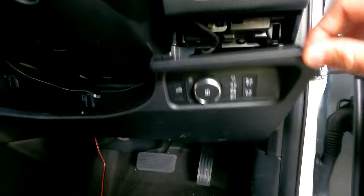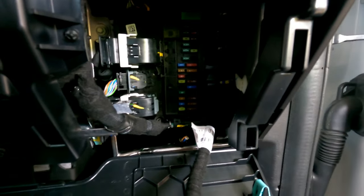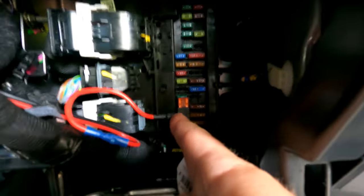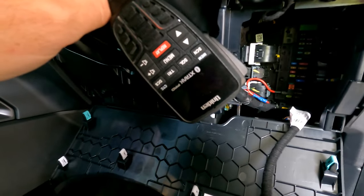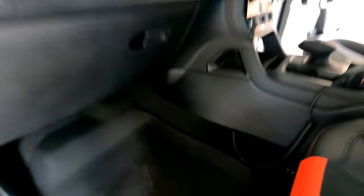So, the panel with your light controls just clips forward — it is a bit tight the first time you pull it off. Then we've got our little fuse box in the back here. I need a micro circuit. We've just literally put the add-a-circuit into position 36, which is the rear parking gate — accessory power. Comes on with accessory power, off without. Happy days. Earth down there. I managed to find some dead space in behind the carpet — if I get the unit down there it would probably sit a bit better, but for now that's okay.